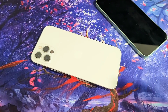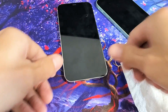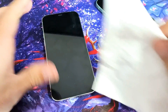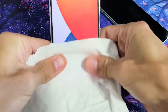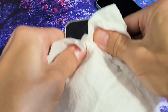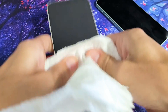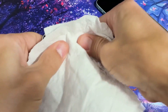If you're still down, the next thing is what I call the massage method. Go ahead and get a paper towel, towel, or some kind of rag if you don't want fingerprints. I want you to press in all over on the screen and on the back. Put both hands on both sides of the phone and press on the screen. Sometimes even though you have a black screen, when you're doing this, all of a sudden the screen will pop on. Give it a little bit of pressure.